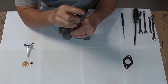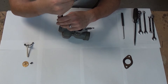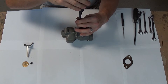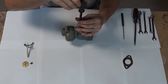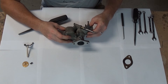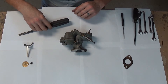They're pretty much the exact same sort of screws that we routinely shake apart on our T-speedster. If your carb is exceptionally dirty and crusty, you may want to take out the plugs and chase those paths. This carb has two lead balls pressed in the bottom. So you have one, two, and then you have this plug here. If you take those three guys out, then you can chase all the circuits — all the drillings in the whole carburetor.